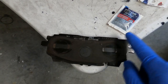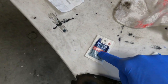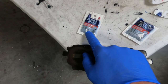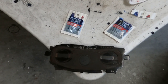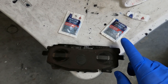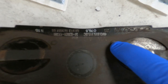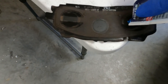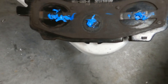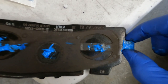Here's one of our brake pads on the workbench. Ideally you'd remove the metal backing and then put your brake quiet — or what we're using, this ceramic glide. These packets are less than two bucks each, and one packet would probably do all four on each axle. I bought an extra just in case, but if you're not doing this for a living you don't need an entire tube — it'll take years to use and I don't like things sitting through too many seasons of temperature changes. Since these are non-removable — basically riveted in — we're just going to put a light coating at their contact points, and also where they slide in the metal tabs as the pads are applied and release.